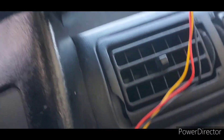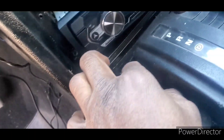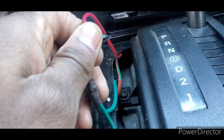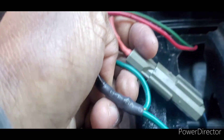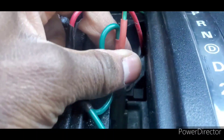And then the yellow wire is for the illumination — basically for your light. What I did was I ran the wire and tapped into the wire that goes through my shifter light and all that. That wire should be your blue and green, or blue and brown wire. That's the wire I tapped into for that.